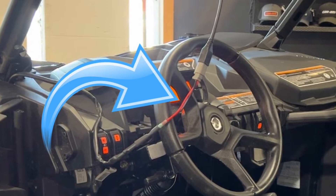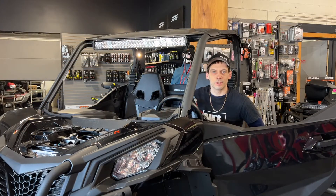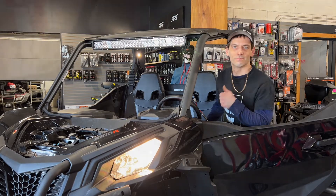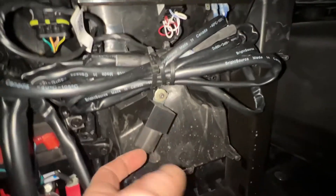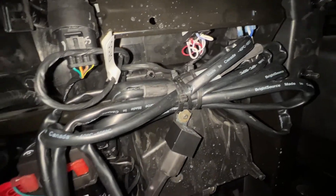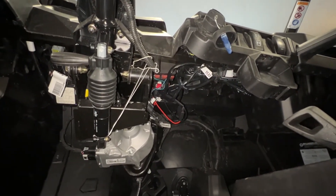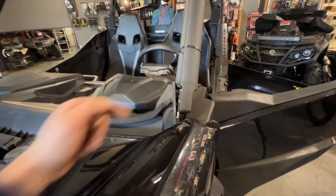The connector that came on the wire harness did not match the connector on the light bar itself, so I had to cut it off and use some buck connectors to attach the connector that came with the light bar. Before you tie up all the wires, just make sure it works — works great! Now the last thing I need to do is take a handful of zip ties and go around and tie up all that loose wiring. I did go ahead and stick a plastic screw up through the relay securing it to the dash, and I've got lots of zip ties securing the wiring to the frame — very nice and clean, nothing hanging down except the fuse there so that it can be accessed if you need it. Also make sure you stick a new zip tie on the rubber boot going through your firewall, a zip tie on the frame, and plenty of zip ties on the wire going up to the light bar. The last thing I need to do is reattach my plastic panel and put the window back on, and then we're good to go.